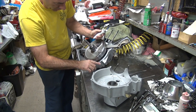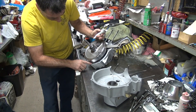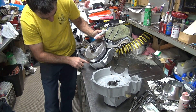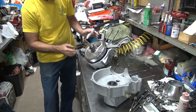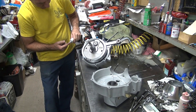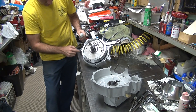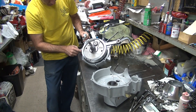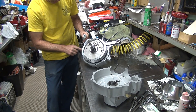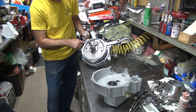Unless your case has a big gouge in it, then you probably should have done something about that beforehand. What you're going to do is basically prime the surface — make it get an even coat on it. This stuff doesn't like going back over it twice, so put it on there quick and be done with it. If you keep going over it, it starts making big lines — big stringy turds.